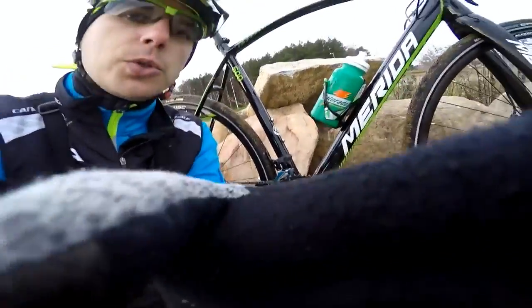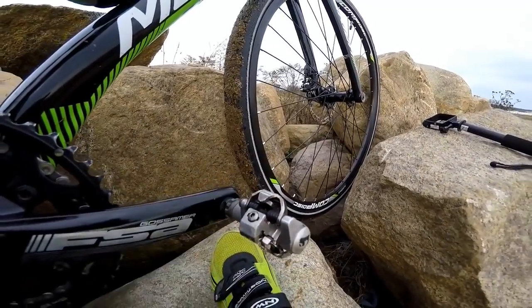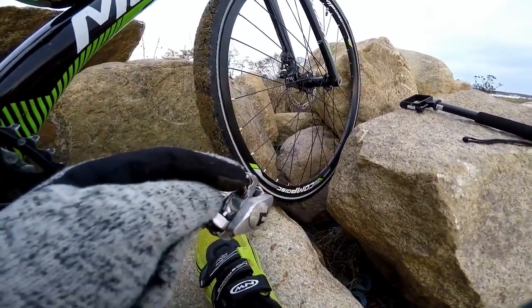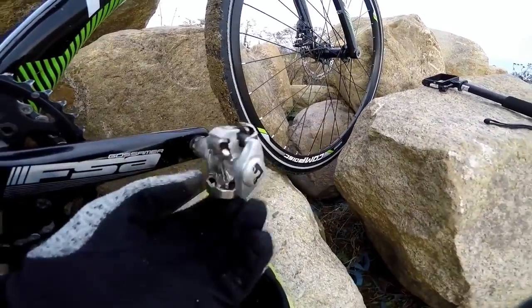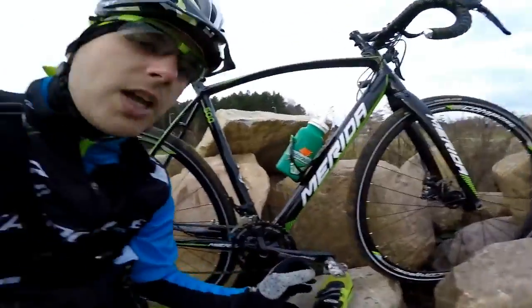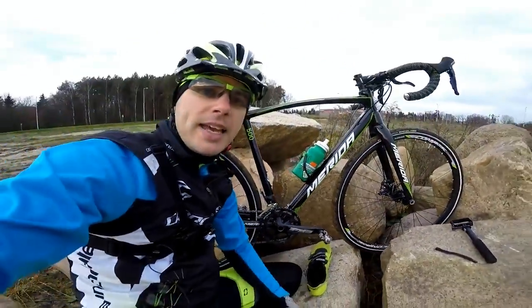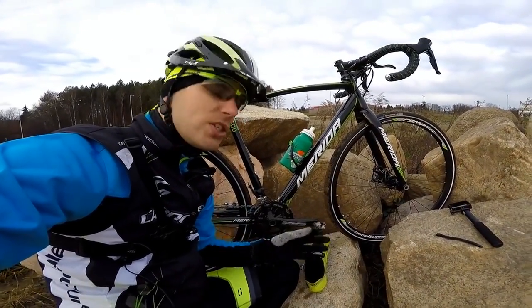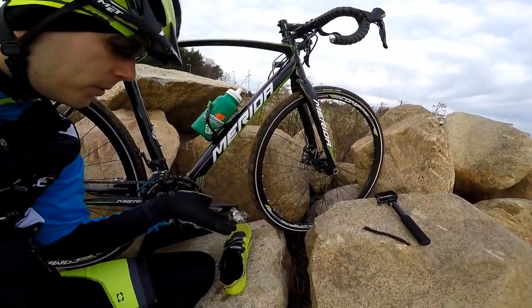What should you know when you buy clipless pedals? First of all, most pedals have this regulation here — you can see this little screw. By unscrewing it, we are lowering the tension on the spring, and that means that clipping in and clipping off the pedal will be much easier. We have two such regulations, for both sides. This is an old PD-M515 Shimano pedal which works very well. If you start using clipless pedals, just unscrew those bolts completely and then clipping in and clipping off will be very easy — but remember, you can then also unclip by coincidence, so this is just for the beginning while you learn.